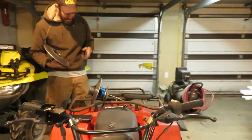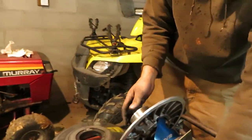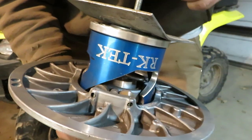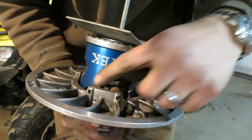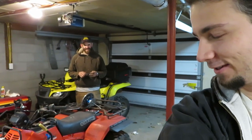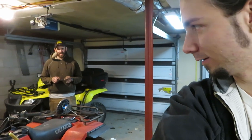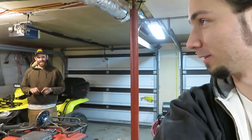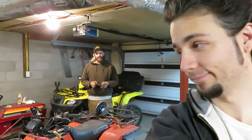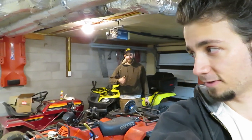What do you got going on over here? I found a pretty similar clutch design and found that a roller is cracked. My sled doesn't have reverse so these rollers never get used. I'm just going to flip-flop these rollers around so I'm good to go. Hopefully this isn't going to eat belts anymore, and then we'll be ready for the season. Jason, thanks for coming over. Hopefully we can get these going, get on the trail, and get back to the truck at the end of the night. Happy birthday to Sea Dog! Hit the subscribe button to see more sled riding videos up in the UP and central Wisconsin. Take care, stay safe, stay swanky. Bye!